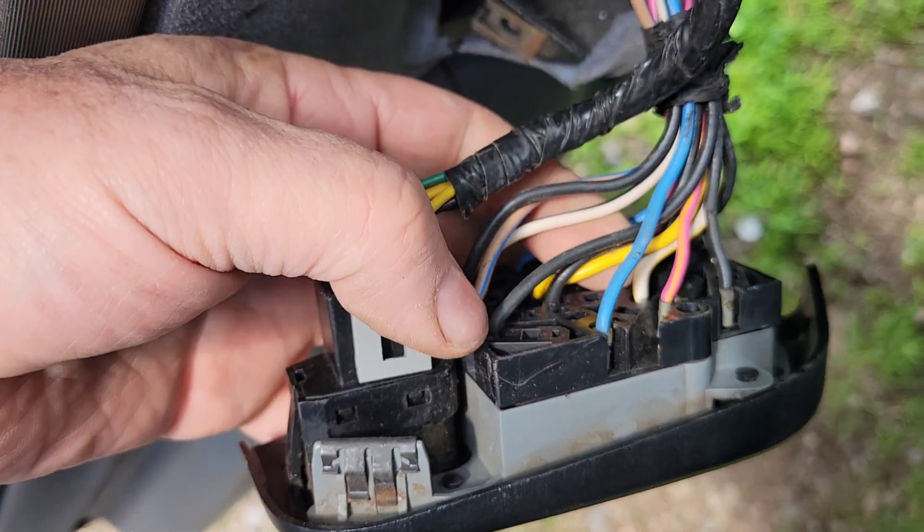I'll see what I can do and get in here to find the common blue and black. Working with a rubber grommet over wiring is real fun. I grounded out the e-brake, and when I touch the blue/black — there we go, I got a light. So I do have power, and I have the same thing on that side too. I actually do have power to both switches. Now I'm leaning toward a ground issue.